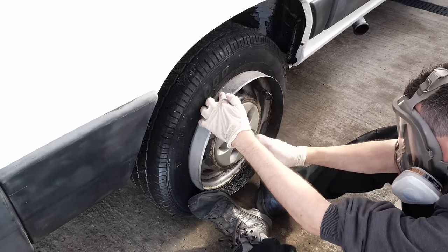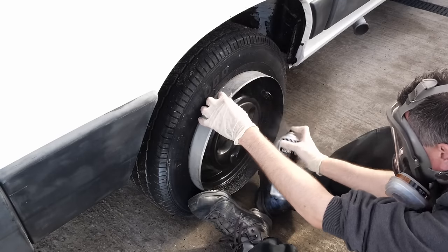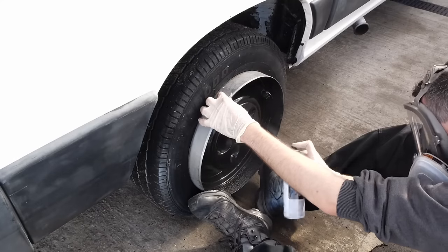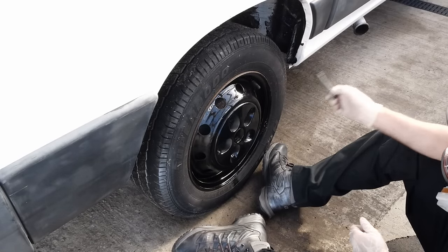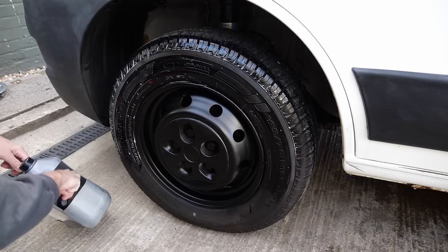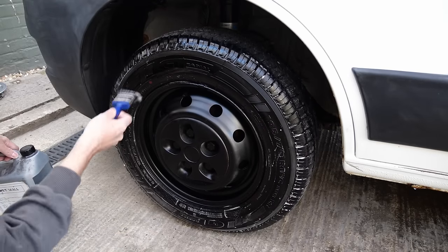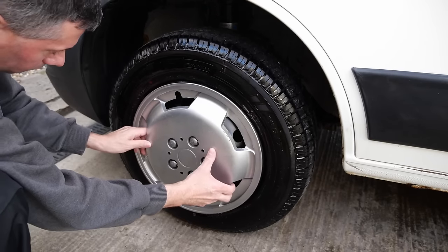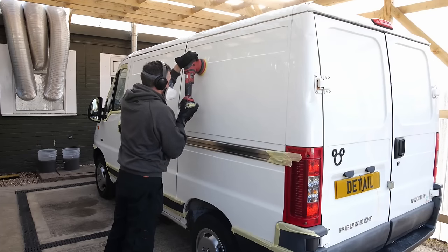One of the things I've done at the customer's request is to paint the wheels. They were a bit rusty so I pulled the wheel trim off, gave them a wash, went over them with a wire brush and some sandpaper first. Then I used a can of Hammerite-type paint with rust-preventative materials in it and just sprayed the wheel. It's not a concours job but it's going to improve the overall look. A bit of tyre dressing, pop on the wheel trim, and whereas you would have had a silver rusty wheel in those gaps, now it's all satin black and looks nice and uniform.